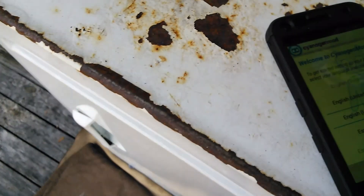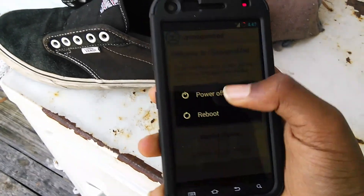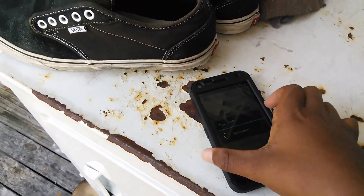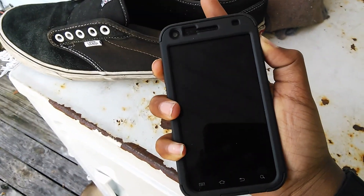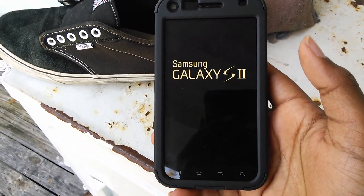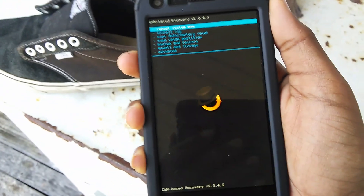I'm back and we got ourselves CM10.2. Right now you're in the setup — don't even set up. Just go ahead and power off your phone as soon as it's booted. Don't even worry about the setup. Then you want to hold down the power button and the volume up button again — hold it down until you see Samsung Galaxy S2. It'll boot you into ClockworkMod 6.0.4.5. As you can tell from the last section, it booted into 5.0.4.3 before. To even flash CM11, you have to have the latest version — that's why you had to flash two CMs. So let's go ahead and use the power button this time to wipe our data.